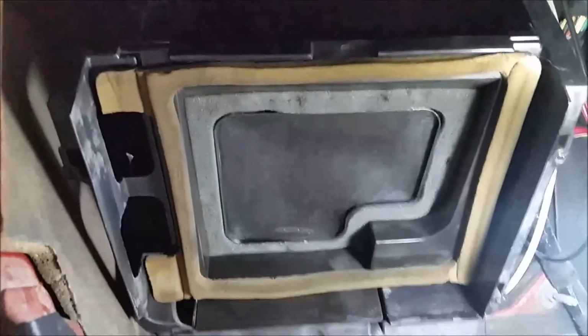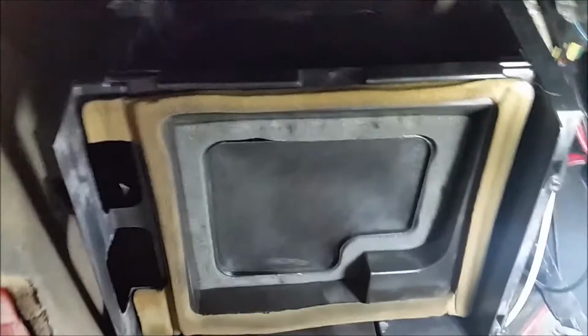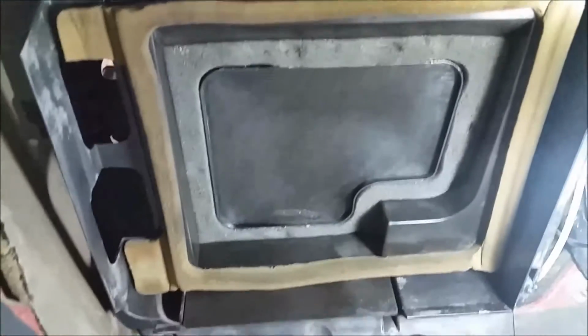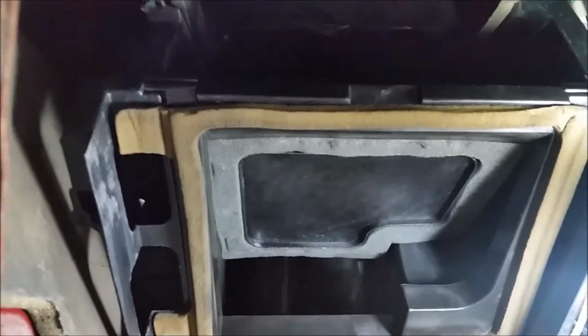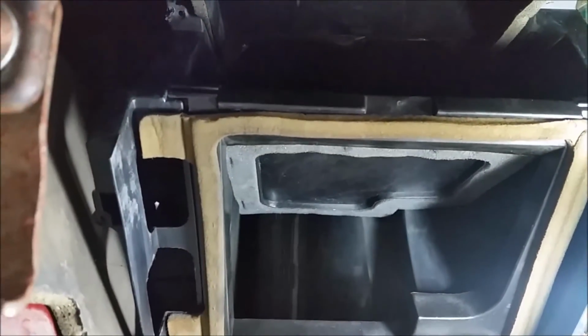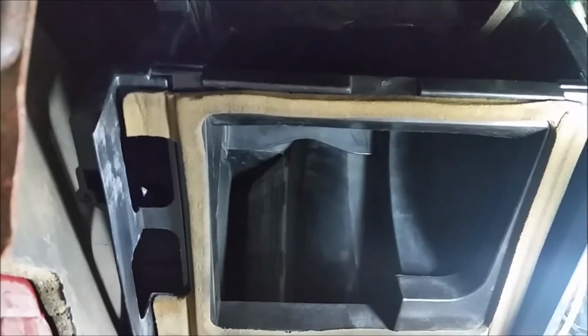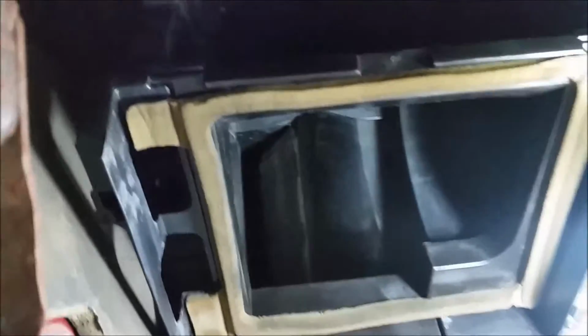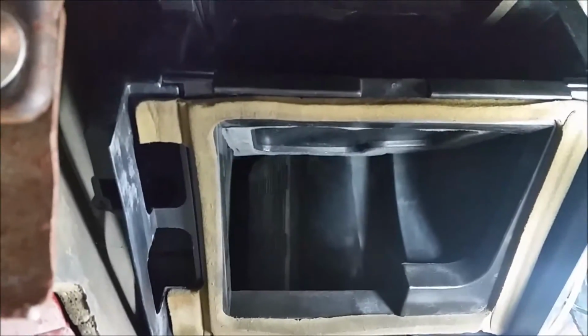Okay, we're going to show you how this works. This is for temperature. So when I turn on the temperature, it will move up. Here we go. This is for warm, moving outwards. That will blow the air through the heater core, which is going to be sitting there in a moment. And we'll bring her back down again. So that's the way it's supposed to work.